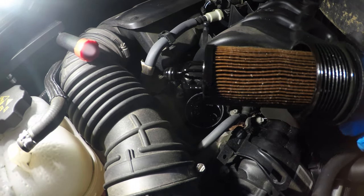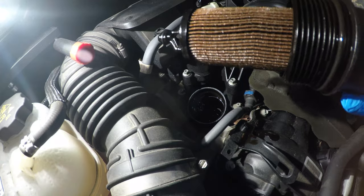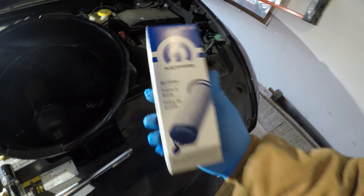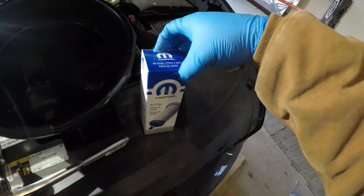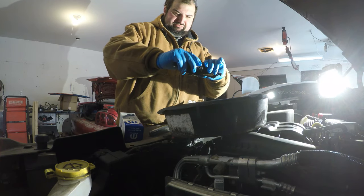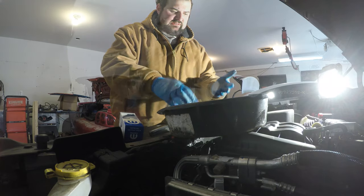It is clipped into the cover. You can see it's pretty dirty — this has about 7,600 miles on it. I go by the oil life filter on the dash; it was at about 28% this morning. I only typically use manufacturer oil filters. This one is MO-349, a brand new Mopar filter for the 3.2 liter V6 in this Jeep. It comes with the filter itself and a new O-ring, because they recommend you replace the O-ring every time you change the filter and oil. I'm going to take the old filter out of the housing — it's kind of snapped in there.